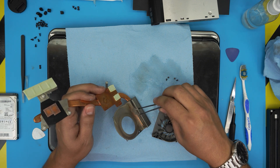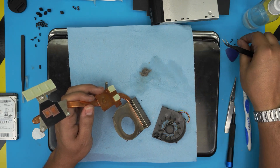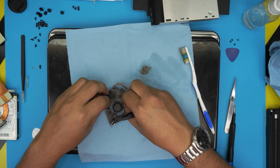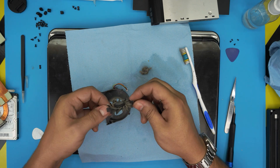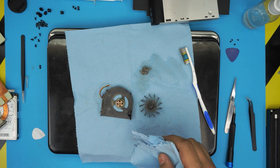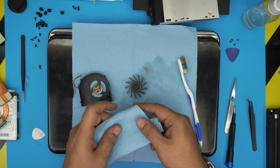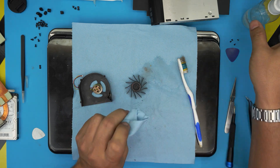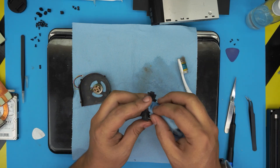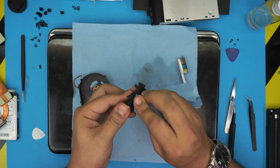Take the fan outside and clean it up nicely by blowing air through it. Then remove the screws and use a toothbrush to clean it further. Lift up the fan evenly and there's the motor. Service the fan: first clean it with a toothbrush to remove all the dust on top, then grab a corner of the workshop towel, soak it in alcohol, and rotate it right inside the motor housing to clean it thoroughly.